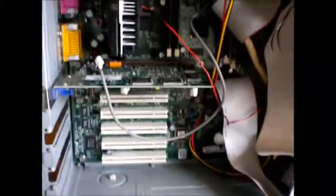The power supply fans seem to work. I noticed the wattage on this power supply is 330 watts - totally overkill for this system. It's even got custom sleeved 24-pin and SATA power, so it's got to be a relatively new power supply. No hard drive. We do have a front case fan. I removed all the expansion cards that came in to troubleshoot. It's got a replacement CMOS battery from 2006, so it may or may not be good.